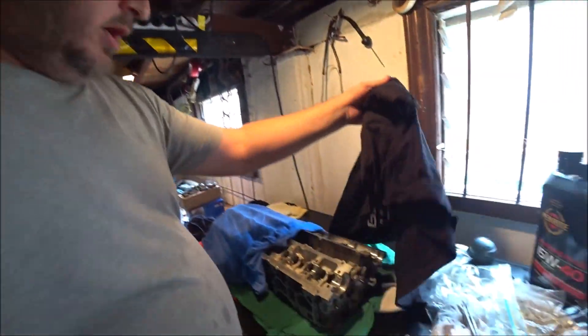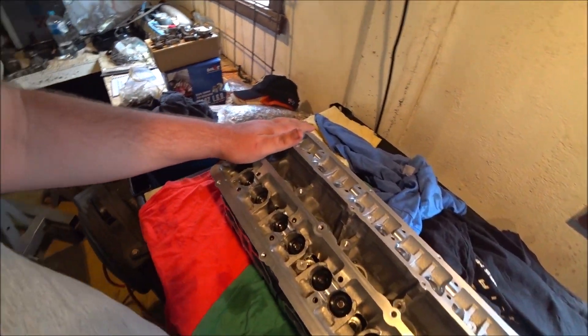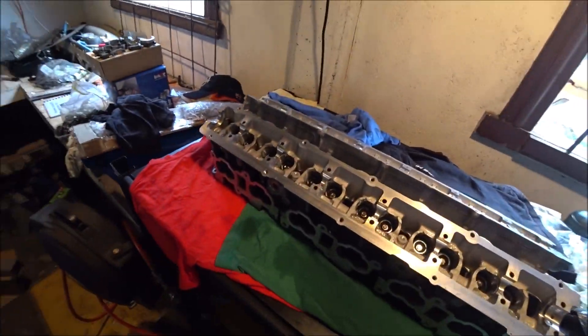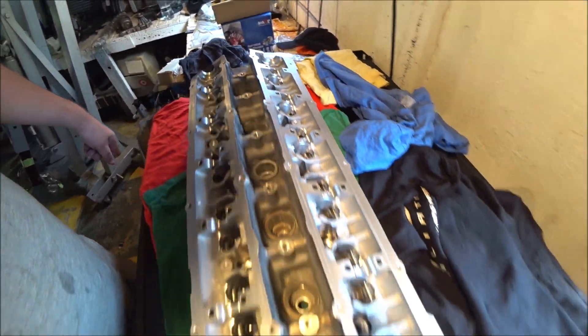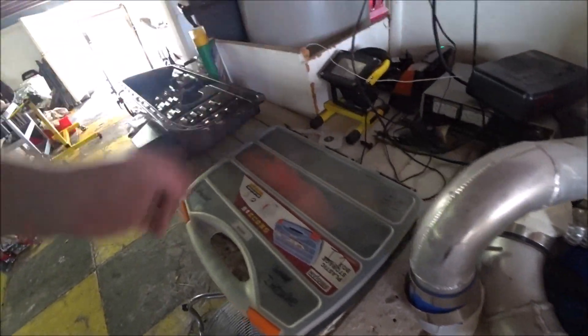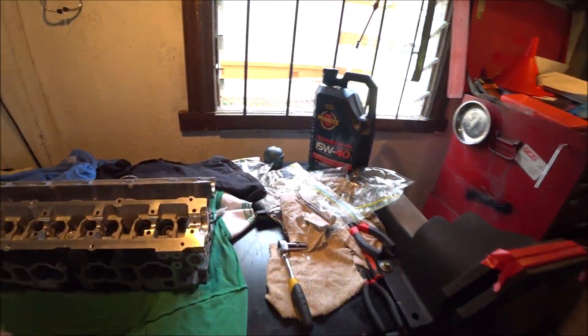Morning YouTube and the Internets. I got frustrated with putting the valve train together last night. I had a mate come over this morning so I had two sets of hands holding the head still while I did the compressor and put the collets in - but that's done. It took a few hours - like an hour and a half this morning to do three-quarters of them, and like four hours last night to do one quarter. But she's here, ready for some buckets, which I've had sitting over here after rebuilding them, soaking in goodness - by goodness I mean oil. Intake 1 through 12, exhaust 1 through 12.